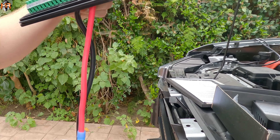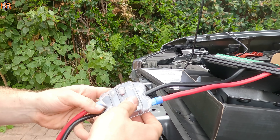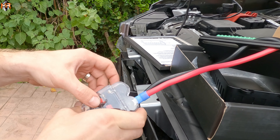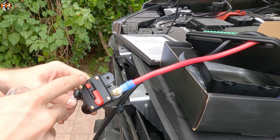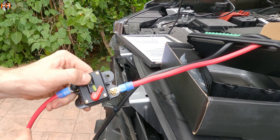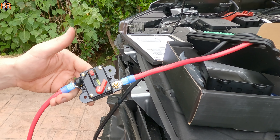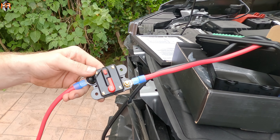For safety when connecting to the vehicle, there is a fuse box here. I'm going to take off the clear cover and disengage it by pressing this button — if it's in line, that means current is going through it. So when connecting to the battery, I press the button to disrupt the current so there's no electricity going to the box while I'm wiring it up. After we're done, we just come back in here and reconnect it to put power back into the line.